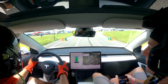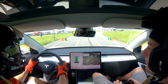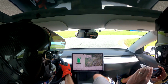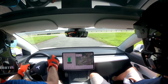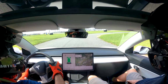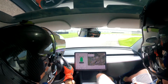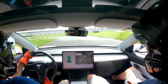Now the dampers: the weight balance is significantly better with the new dampers. It controls the weight much more predictably than before with the stock dampers, and it's very enjoyable. Now, the one thing the dampers still didn't seem to cure, although I put the Unplugged Performance street racing pads on, so I had a little bit more stopping power, is that it still nosedived pretty badly. Hard to tell if that was the extra braking capability compared to before. I don't know. But it still is a significant improvement over the sloppiness of the stock dampers.